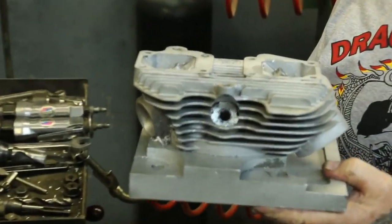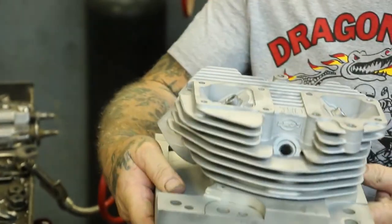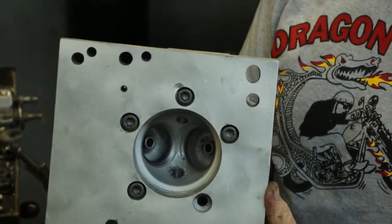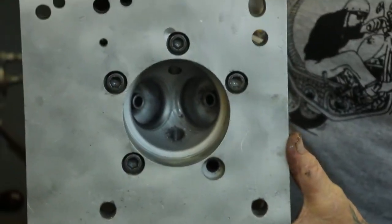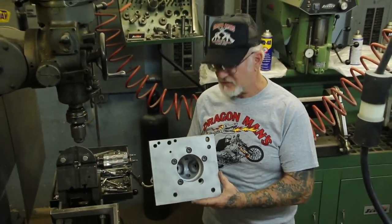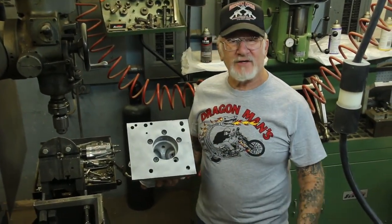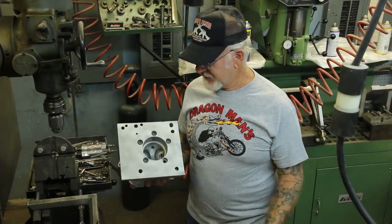There it is — 9/16ths, 14mm spark plug hole. That's the new hole, and this here is the original Harley-Davidson hole. This is how it looks on the inside. Double spark plugs — you need two coils and an extra condenser. The condenser breaks down the magnetic field when the points are open, so you need two condensers. It starts the bike more efficiently, and with the gas they're selling these days, it'll burn more efficiently.